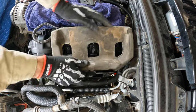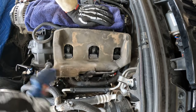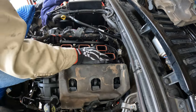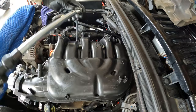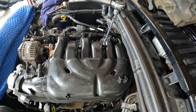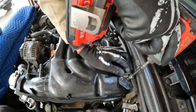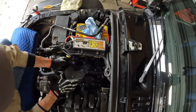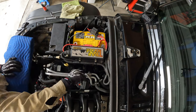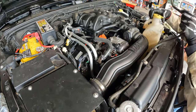Don't forget the foam insulating pad on the driver's side valve cover if you want that back in there. Wrangle some new gaskets onto the lower intake manifold and set the upper plenum in place — cross-pattern torque it to 89 inch-pounds, our lightest force so far. Rear manifold foam pad and engine cover mounts go on next, followed by the passenger side valve cover bracket reinstall. Reconnect heater hoses, any wires or vacuum lines you removed, and the air inlet tube, as well as the coolant reservoir.